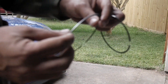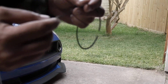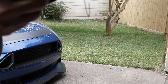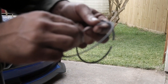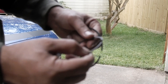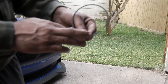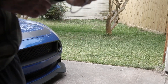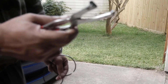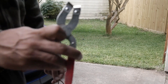Here are our last two rings. You can see these things are definitely thicker. To make sure that you put these in correct, there is going to be a little bit of a beveled edge on these ones here. One thing you're going to want to look for is there should be a little dot on the top of each one of them. Again it's going to be very very hard to see it on these, but trust me there's a little dot here on the side of each one of these. This dot needs to be facing up. So we're going to go ahead and start putting these on with these pliers I got from Drew — I don't think these cost very much, I'm pretty sure he picked these up from Harbor Freight.